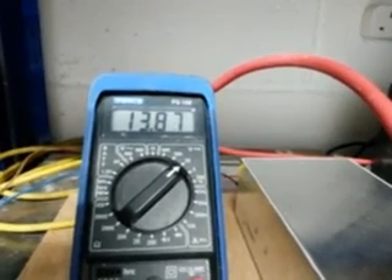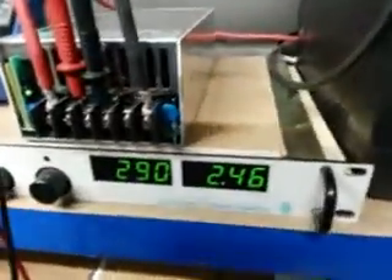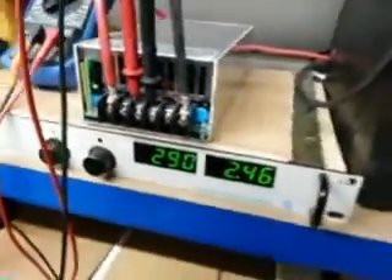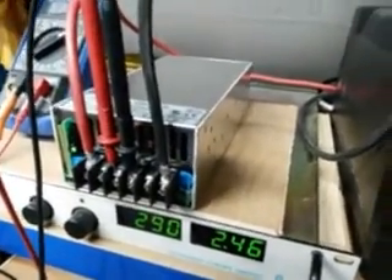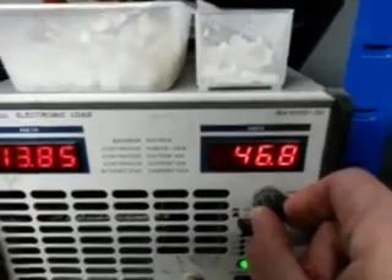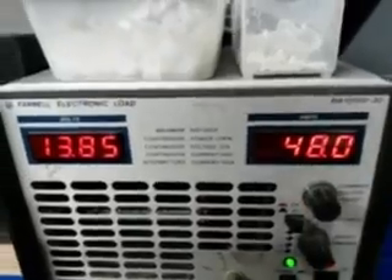13.8 volts is a nice sweet spot for the Honda 12 volt system — that's near enough, 13.81. It operates on this test down to 80 volts and up to 290 volts, which should cover the IMA motor operating range. You'd just add the bridge rectifier — this unit has some rectifier diodes in it and you could actually remove those for a slight efficiency increase, as it needs the special three phase rectifier instead. I'll leave it soaking at 48 amps for a bit and we'll see what it does.